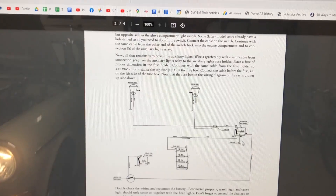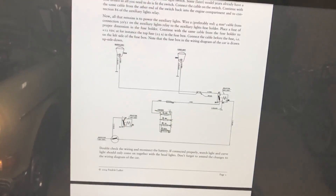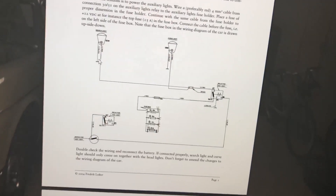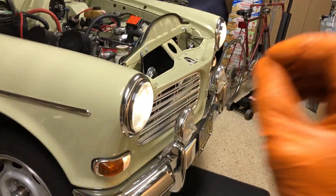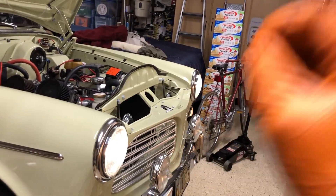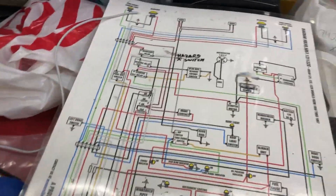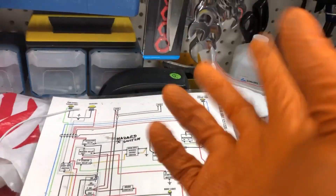They only give you one way, and that's the four-terminal relay. The original relays were three-terminal. The four-terminal is so that you can have — as this customer wants — a California, or basically 50-state legal car for the wiring. By that I mean the fog lights can only turn on with the headlights, and when you turn the high beams on, it disables the fog lights. The three-terminal relay doesn't work for this because it's a little too simple.